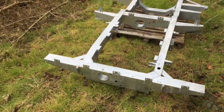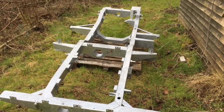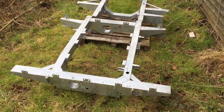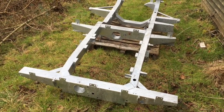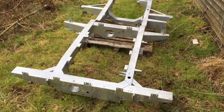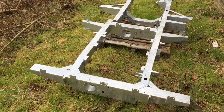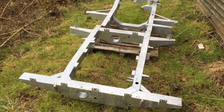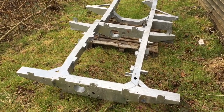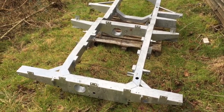I've got the chassis outside because I'm going to paint it, but in order to paint it I've got to prepare it for painting. That means washing it with what's called a mordant solution which takes all the grease and grime off, and then I take it back inside and put an undercoat or etch primer undercoat, then a chassis black.